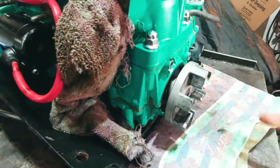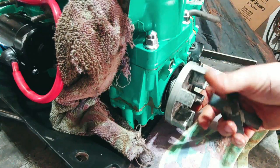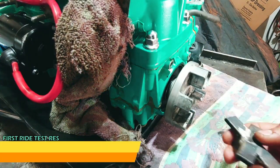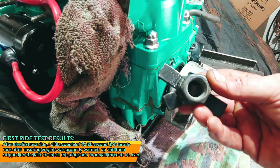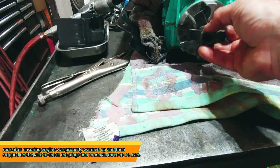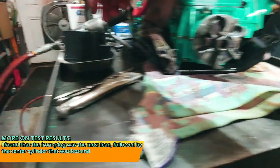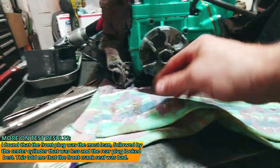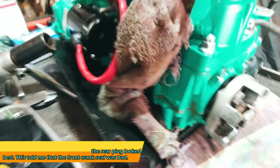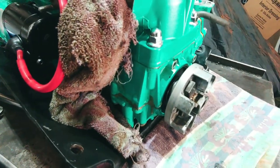All right, guys, so this is my 900 STX engine I'm going to be doing crank seals on. What I have here is a tool that I made. So this fits right into these slots, just like that. And then I got a 1 1/8 inch socket that I can put on there. And so I'm going to try to get this sucker off, loosened up.